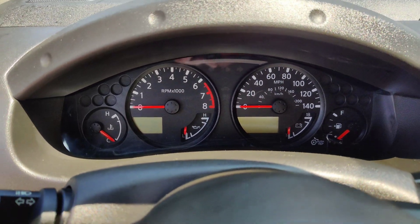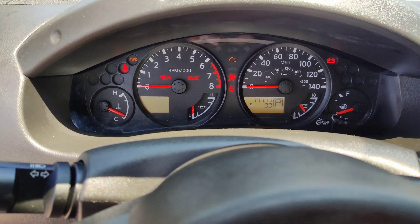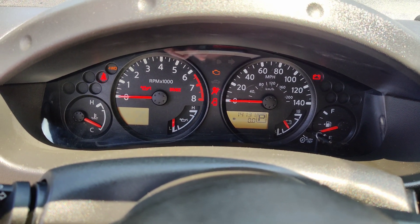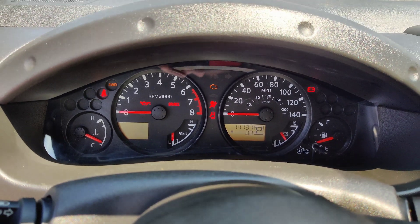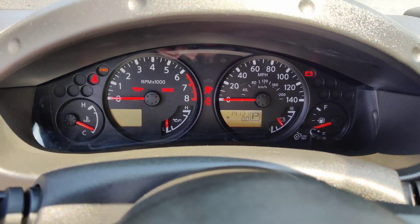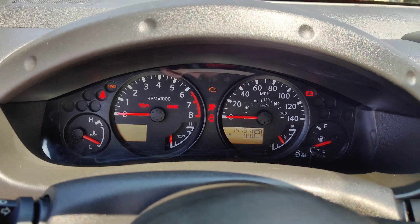I just found a TSB for this. I was reading on IATN something about the airbag light flashing. It said about a TSB - if it flashes on for two seconds, turns off for two seconds, turns on for two seconds, it's in diagnostic mode and you've got to take it out of diagnostic mode. I'm going to do the procedure now. You've got to turn the key on for so many seconds to turn it off and you've got to use a stopwatch - do not use the light as an indicator. We're going to try that.